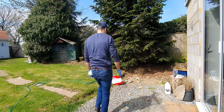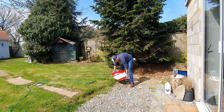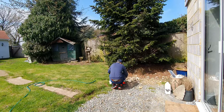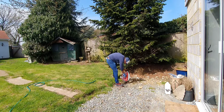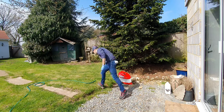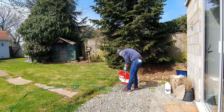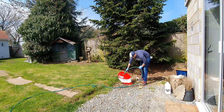This is how it now looks after being flushed and filled up with vinegar. I've taped the top of the tank up and left it for two days, agitating it now and again and giving it a quick spin around. I've picked a nice warm day outside to do this — quite windy but warm — to try and dry the tank out quickly. We've emptied the vinegar out already and given it a quick flush through with some fresh water.